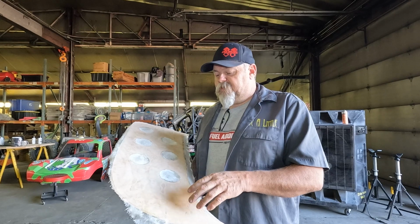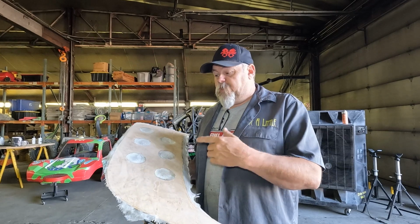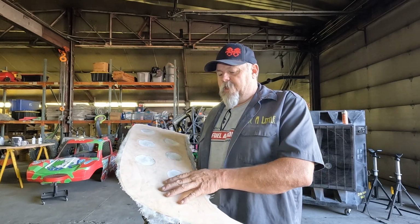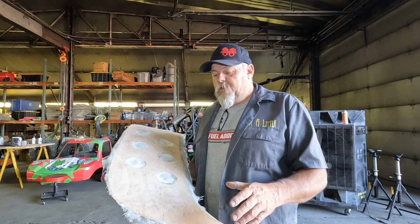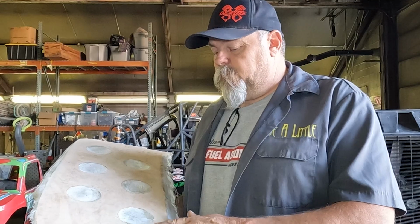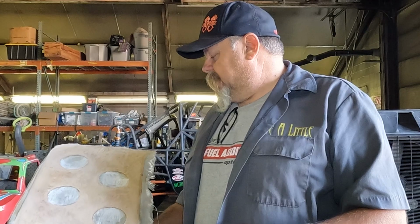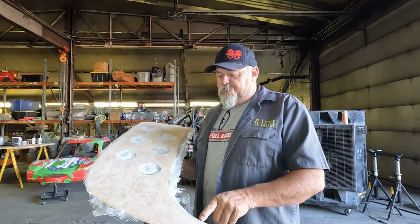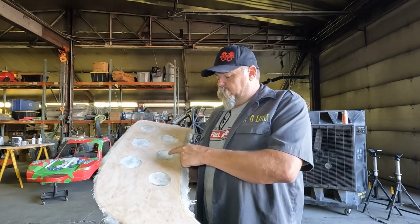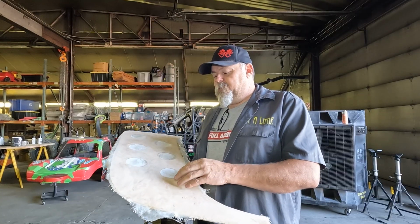I am gonna put another layer of resin on it, but when I sand that, I'll sand it a little lighter, and also when I do the other one, a little less sanding, and I'm gonna hit it with the urethane primer. You could do it out of a rattle can primer as well. Use that to smooth it more than trying to get the fiberglass perfect. But I've at least got enough tooth in it now that I can go ahead and start trimming off the excess fiberglass, which I'll take out of the holes and off the edges, get that lined out a little bit better. Then I'll put another coat of resin on, let that dry, go from there, and then we're gonna work on the rings.